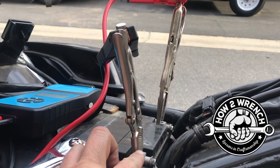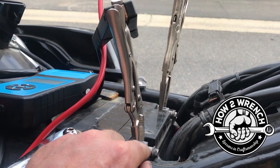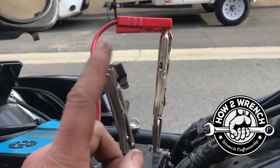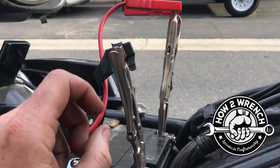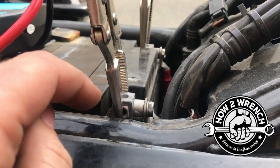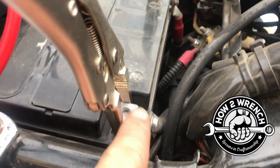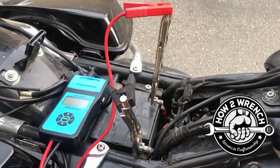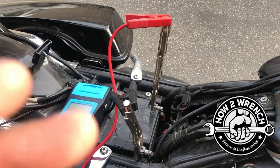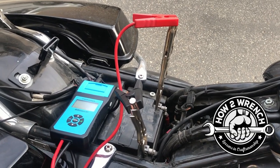A couple pair of vice grips — they're not welded on to where I'm hurting or digging the teeth in, just on there enough to get some good connections. I don't have to worry about touching or shorting out or maybe a cable, especially if I'm doing jumper cables where we don't have a lot of room between the battery and frame and could make contacts. This is a great safe way to go about doing a load test or jumping a battery, whatever you need to do.